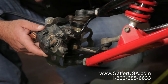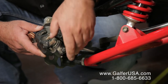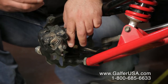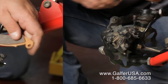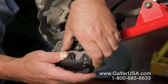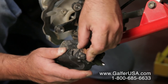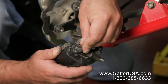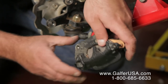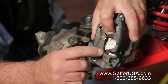Now we've cleaned the pistons. You want to push them back inside — you can do that by hand. We have removed the stock brake pad and we're going to put the new brake pads back on. Put the pin inside, drop the brake pad in, and then just push it inside. You want to make sure that the brake pad always settles inside of the stock shims.